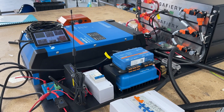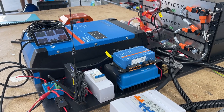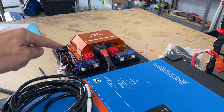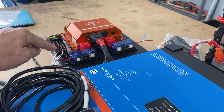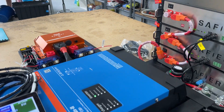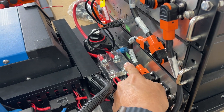This is going under the seat — very tight — being done by Daniel and the team at Leisure Tainment up on the Sunshine Coast. The Scotty there is going to go under the seat, and that goes to a 180 amp alternator, and then from here it's going off to the 48 volt side, which comes in down here for charging.